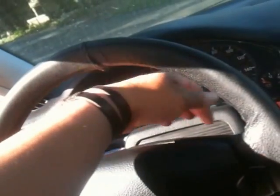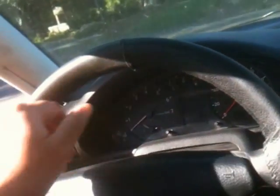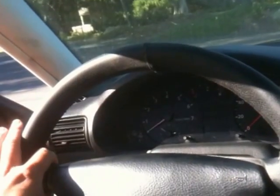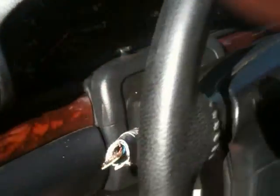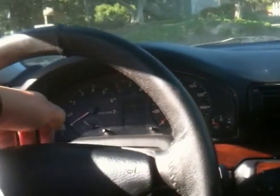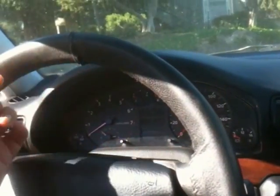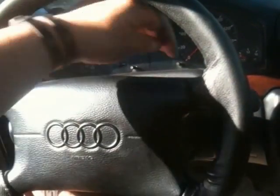Basically the bolts in the back here are T30s, and a lot of people online have been saying to use 6mm Allen head wrenches, and that doesn't work. I think the guy before me that had this stripped them out. Obviously I needed a whole new deal here, and this is busted up, so I got a replacement, a whole brand new one. So T30 in the back, shoot it that way. Lefty loosey, righty tighty, and eventually they'll both pop off.